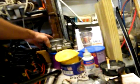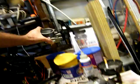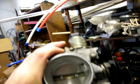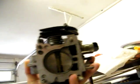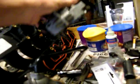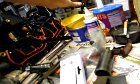I've already cleaned the throttle body up. I probably need to get that new sensor on top — right there. It looks really good. I took it off and cleaned it out real well. Look at that — you can actually see it. It's turned black from all the soot in there. Look down in there. This thing was sooty all over; it'd been backfiring like crazy.